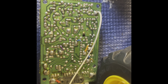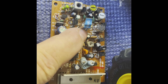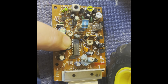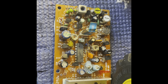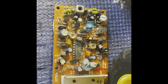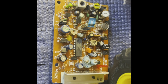When I cut these I like to leave a little nub so you know where each wire went — that way if you ever want to return it to stock form, you could. There's the crystal, and you can actually replace the crystals on these; there's a spot in the battery compartment for that. There's the chip — we actually use these same chips on some of the delay boxes I build. This is the stock electronics, stock speed control, stock steering, and it's not a bad system if you can get it to work. He said he couldn't, so I'm going to strip the motor wire ends and just make sure the motor works.